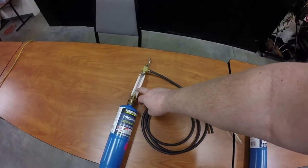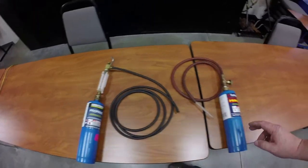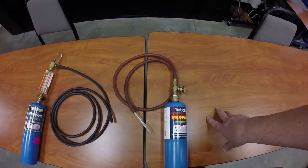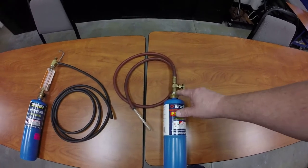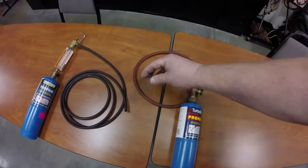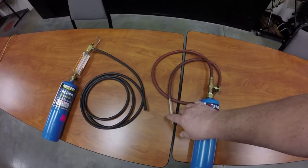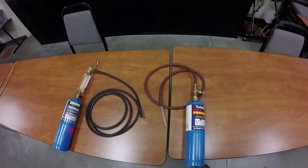They're kind of expensive to find one of these things. These flow meters are really difficult to find as well. So I'm going to show you my backyard homemade tool. This is just a propane torch that I got from Home Depot. You can buy them at secondhand stores and stuff almost free. And what I did is basically just plumbed on a tube, and then I just used an old ballpoint pen as kind of a pointer. And so you crack the valve open here so the propane's flowing through, and you just go through and find your vacuum leak. So I'll demonstrate how this works.